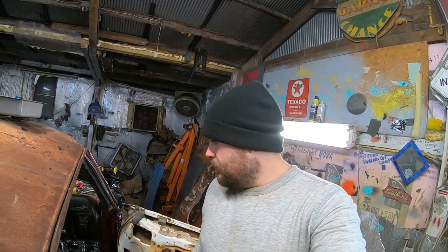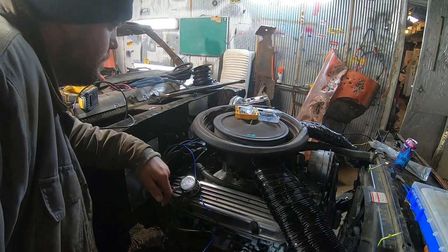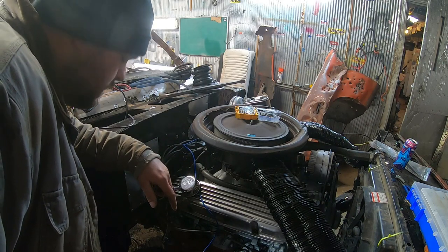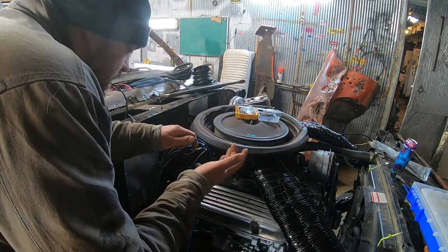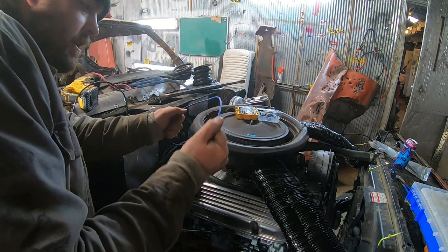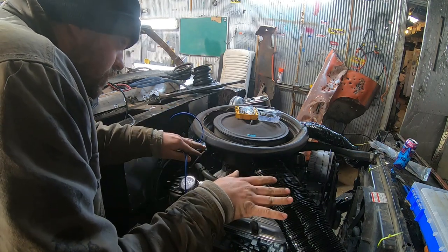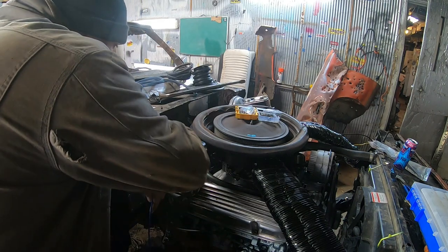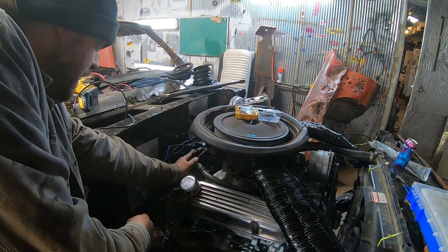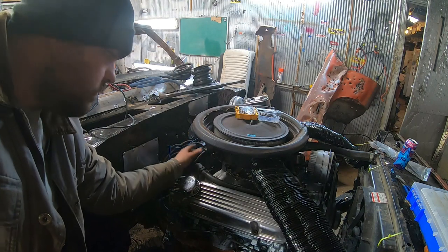Progress. If I wanted to be perfect, I'd still be saving my money trying to buy an $800 wiring harness kit — that's what I'd be doing. If you hear gunshots in the background, just ignore them — it's New Year's Day, and out here it's like World War III every year. We're going to go ahead and wire up our ignition. Not much to tell you here except I just chose a random accessory wire — it looked like a heavier wire. The only important thing: write down somewhere what circuit that is, in case the car goes silent on you and you need to know where that fuse is. Run it right here — it goes right to battery, 12 volts to the coil. That's all you need on the GM HEI. Leave yourself enough slack so you can time it and adjust it.